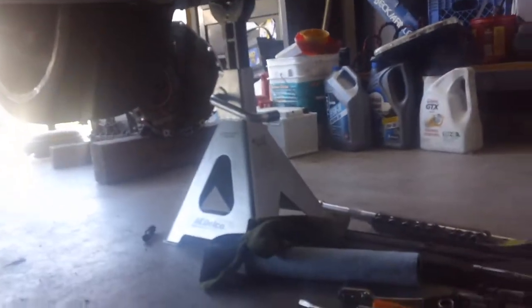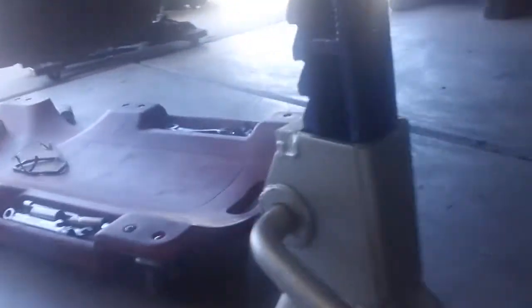How high you have to get — I got these big heavy-duty jack stands that go pretty high; I think these are 6 ton. Yeah, it's a 6 ton. Because I have a bunch of the smaller normal jack stands that people usually have, and they're just not quite high enough to get the clearance you need to get a transmission out.